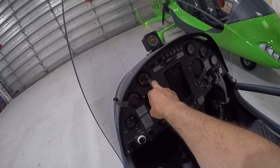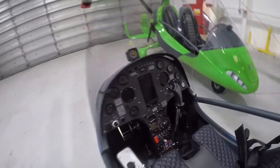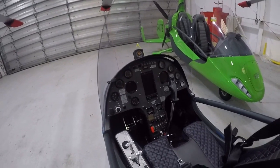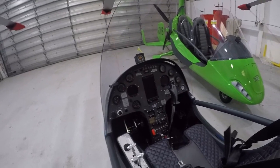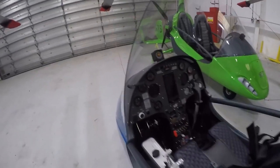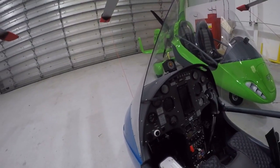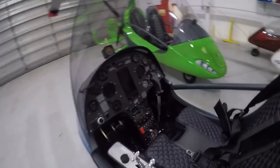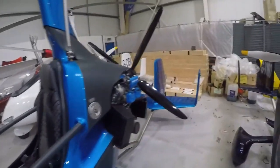With the 912 model the extra drag of that pre-rotation capability basically dominated the 912, but I don't expect it to dominate the 915. Indeed, the company are quoting takeoff performance to clear 50 feet of 660 feet, which is better than half the distance of the 914 variant — the 914 requiring more than 1,300 feet to clear the same 50 feet.